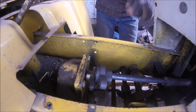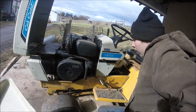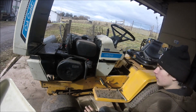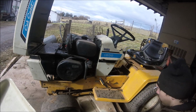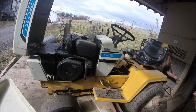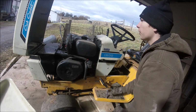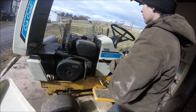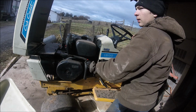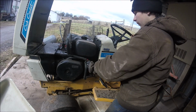If I can get the socket off. Okay. We will now take this bolt out here. That's a 1/2 inch, but of course, like I said, I don't have my right tools up here, so I'm just going to use a metric. It's not what you're supposed to use, but metric size 13. If you can see that, try a 13 millimeter. Fit on it and not slip. Actually, it fits on there fairly decent. But like I said, that'd be a 1/2 inch, not 12. That'd be a 1/2 inch standard.